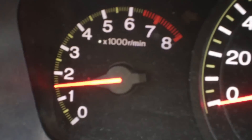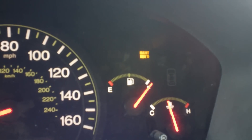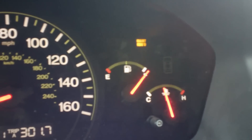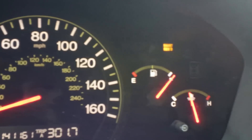At this point I was both encouraged because it got better, and frustrated because something else might be wrong. But then I lucked out — without doing anything else, everything improved. It must be the idle control learning algorithm kicking in. At cold start you can see 1500 RPM is normal, and once the temperature gets high enough it stabilizes around 800 RPM. The maintenance required light just means I need to change the engine oil.